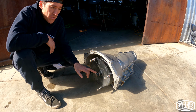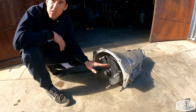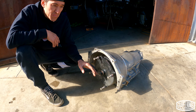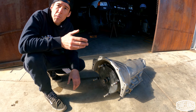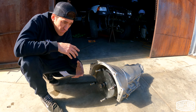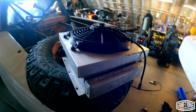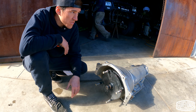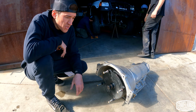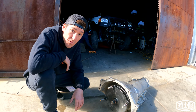Another important step on this is actually adding some fluid in the torque converter before installing it so that it's not just running dry. Because on a brand new converter, you definitely want to make sure there's fluid in there to pump everything through and just get everything going. We're actually installing a nice large transmission cooler, so that'll increase the fluid volume for the system. We got BP's transmission all set up and it's in the truck already, and we should be bolting this thing up soon.